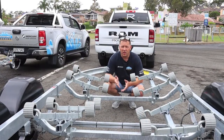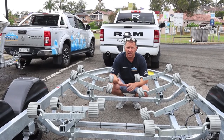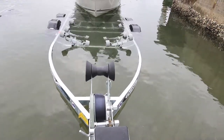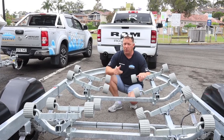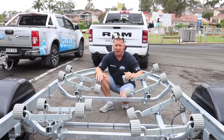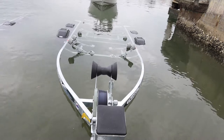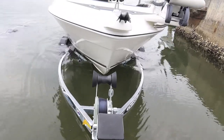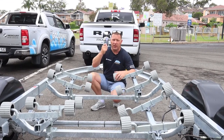This is the view that your boat will have when it's coming onto the trailer — it's a whole line-up of rollers. There are lots of different trailer systems on the market: carpeted skids, keel ladder roller systems, truckloads of options. Hands down, with my experience using boats and driving on and off trailers, you cannot beat the super roller system — this multi-roller system with no keel rollers in the middle. When the boat's coming on, the keel falls into the cradle of these rollers and it can't get out of that — it's fully locked into the dead rise of the V of the hull. Once that boat settles into the cradle at the front, you just power it straight up. Your boat might move maybe a few degrees left or right, but it's fully trapped, which means you don't have to think about it. The trailer does all the steering for you — just bring the boat up to the winch post, click it on, and it's super easy.